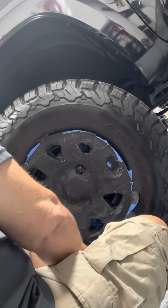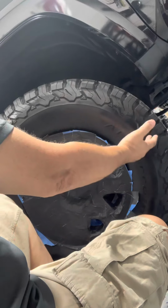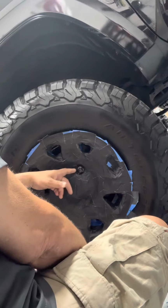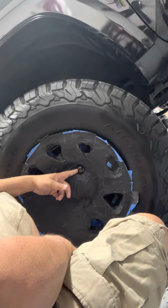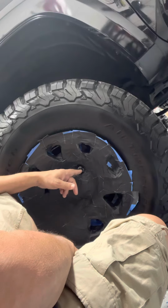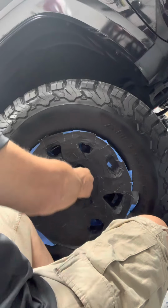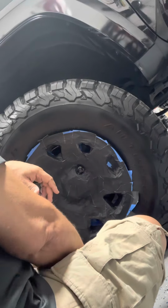You're probably wondering what I'm doing. I'm not painting my tire, but what I have is protection for the rim. Why am I protecting the rim? Because this nut and stud are both spinning together, so I'm going to have to drill it out. Going through here with a small bit, bigger and bigger until I eat away the stud. So this can come out, and then I can change the tire, because I do have to change.